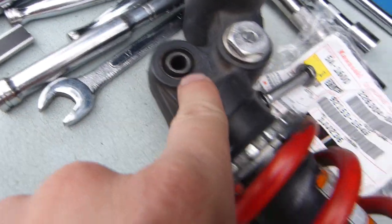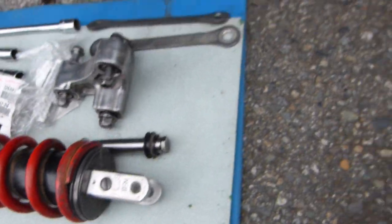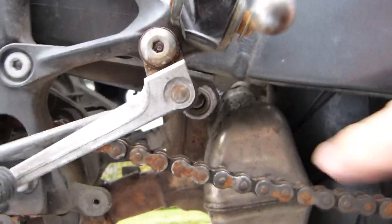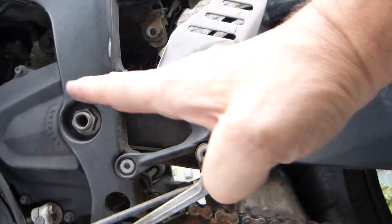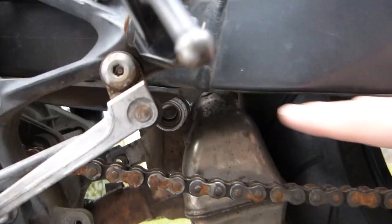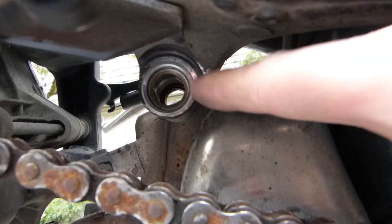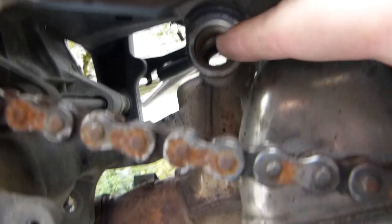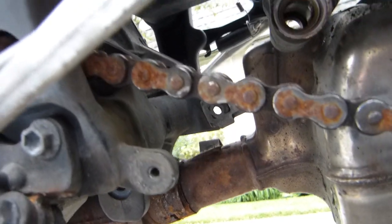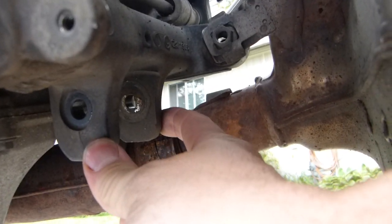So that's the upper mounting point and that's the lower mounting point, and it doesn't mount to just one point on the motorcycle — it mounts to two points. One mounting point is here on the swing arm, which moves up and down as the rear wheel goes up and down. There is a second mounting point right here — this bracket here, part of the frame.